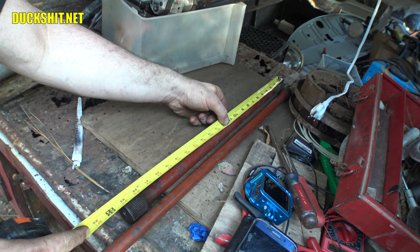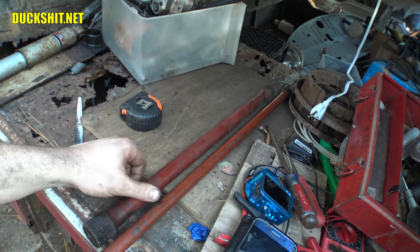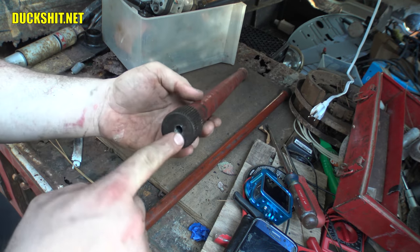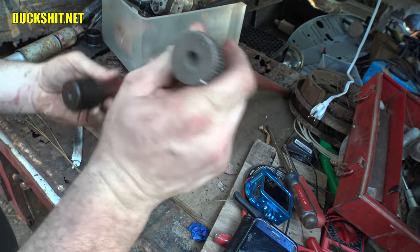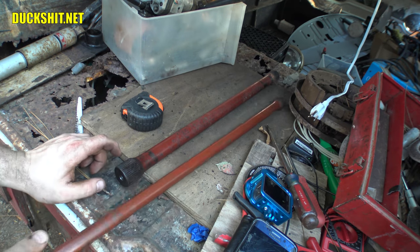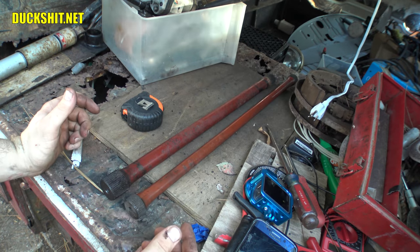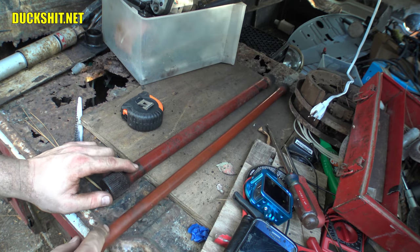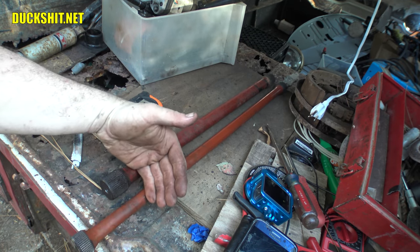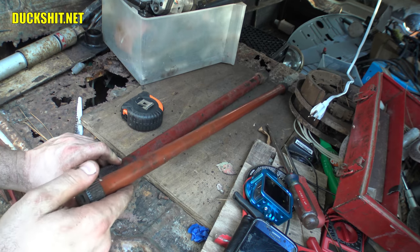The problem with the early bus ones is they're a little hard to find. Dimensions look like we've got 23 and a quarter inches long, and I'll have to get my calipers out but I'm going to speculate it's probably about 30 millimeters diameter. You can see the hole I drilled in the end there and tapped it out - ran that bolt in, did a pretty good job, a little off-center, but even Volkswagen puts their hole off-center. The beetle bar won't work for a couple reasons: one end has the same splines as the bus bar, but the opposite end is completely different. Secondly, the length is different - the beetle one is gonna be much longer. They made them longer to make the spring a little softer and give it an easier, less harsh ride. Also the diameter is way too small - it's gonna cause the bar to twist too far and might just fail from being over-torqued.